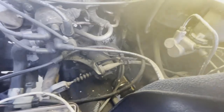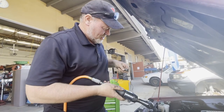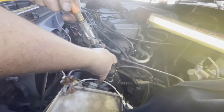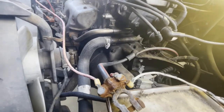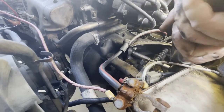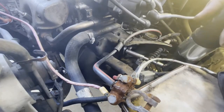We have this bolt right here, and then a bolt underneath, but the problem is the clutch cable bracket right here is in the way — so we're going to go ahead and remove this first. We have no battery so I don't have to worry about disconnecting the negative cable. Using an air ratchet with a 13 millimeter deep socket. The deep socket might not be enough because of the cable — this is where you realize you need an extension to get around what's in the way.